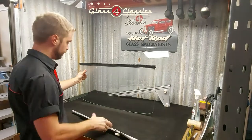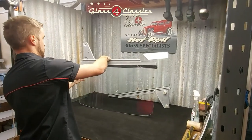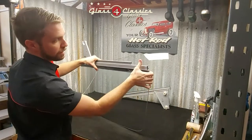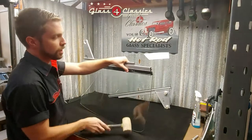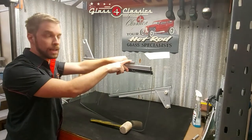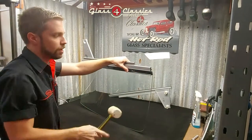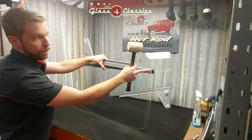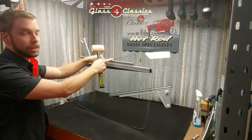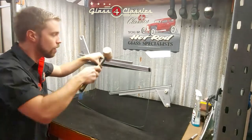Lining this up — remembering this goes to the back edge. Start at the front here. We're going to start this with a rubber mallet. You don't want to hit this too hard. You want to start here to get this sitting in place in line, then work your way along gently. Do not hit this too hard — you will bend it and the guide wheel will get caught halfway along.